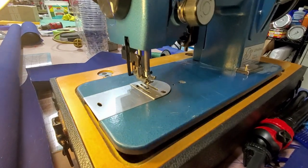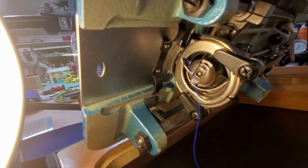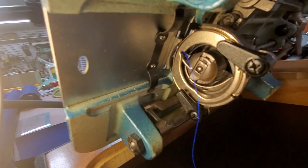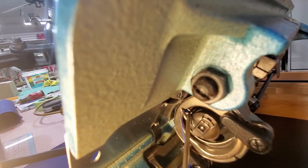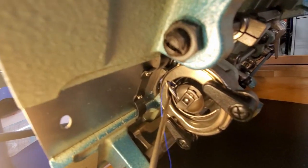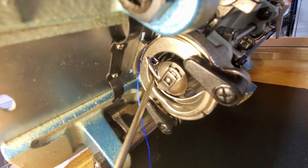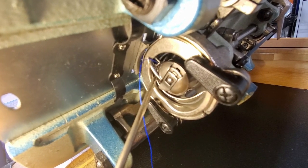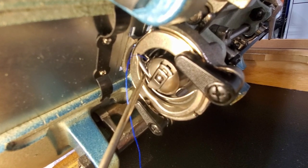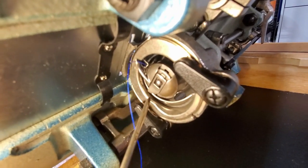I pulled it apart and figured out what was wrong. I'm going to show you the part — I don't remember the exact name, but this outer piece, the pickup hook right here, is damaged. I've seen videos where they tell you to check it for a burr; if it's got a burr it can get finicky. But it's got more than a burr — it's got needle strikes on it that are pretty significant. So I can't just burr those out.